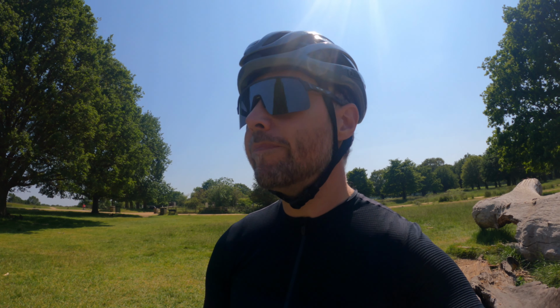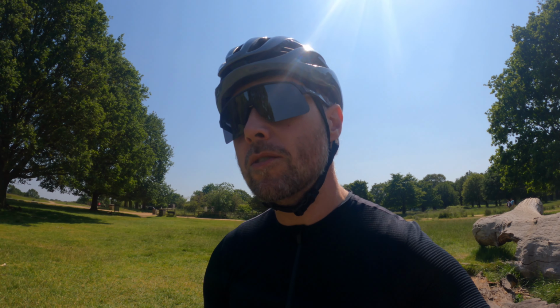I think that's quite hard, right? But ever since he first serviced my bike, I've kind of lived by that. So every couple of rides, I'll give the bike a little wipe over, no water, just get the dust and dirt off. You don't need to do much. I'd probably do it every 3 rides, with a bit of GT85 on some cloth, run the chain through it, sprockets, cassette, then give the bike a wipe over. Sometimes I'll take the wheels off and give them a hose down, and that's just the tyres basically.